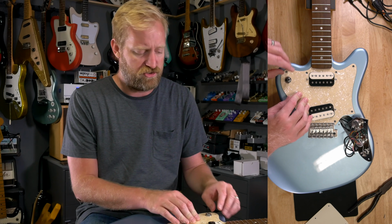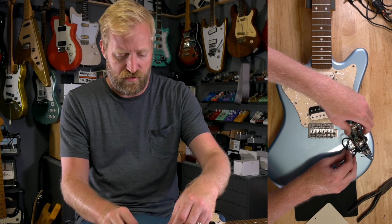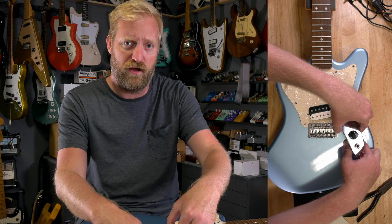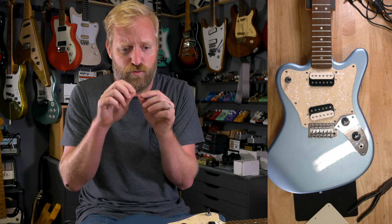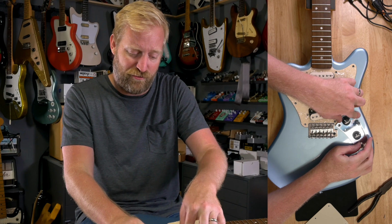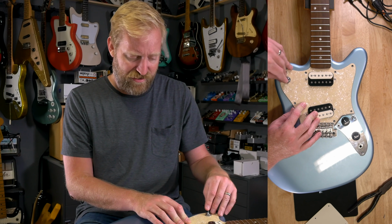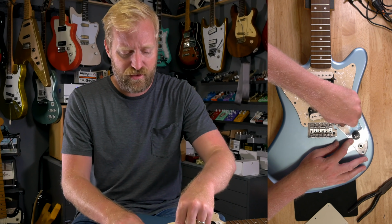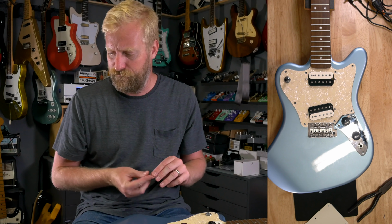Oh, I fixed the switch. So much better now. Thank goodness I could do that. I don't have to replace it. So if you get one of these and it's got a squeaky switch, open it up, get like a toothpick and dip the end in WD-40 and just dab it around in there. Don't spray it, because I don't think that will result in good things. But just get a tiny little bit in there, and that killed all that squeak. Jeez. Not only was it loud, it felt bad. I didn't like the feel of that squeak.